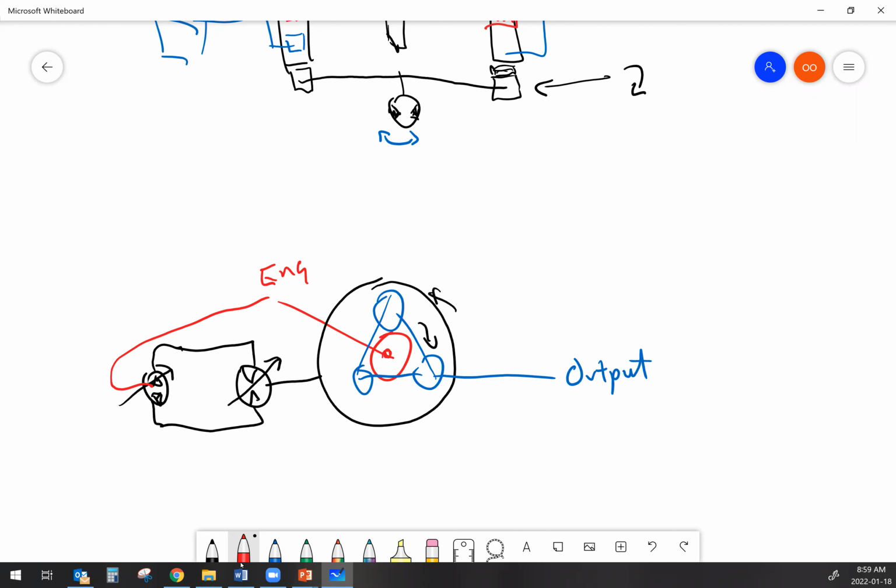Now, do some manufacturers decide to take this several steps further and add on what's effectively a range transmission to the output? Yeah, they do. Go take a look at Case and some John Deeres. To the best of my knowledge, the Fendt ones are pretty much just sticking with what I've got here. They're not all full of gears and clutches and all that other stuff. It's a very, very simple transmission design. Yeah, that's true. It's not cheap, but it's simple.